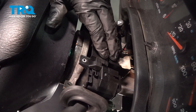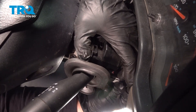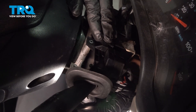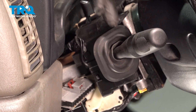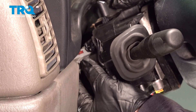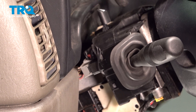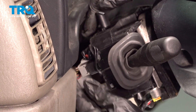Now I'm going to do my switch on this side — that's the wiper side. Push it till it clicks, and push that little red tab right in. Now we're going to the actual turn signal and headlight switch, put this connector in, line it right up, push it till it clicks. You can hear that clicking already — that means this relay, the four-way flasher, is on. That's pretty common. Push that safety lock in, that red tab.